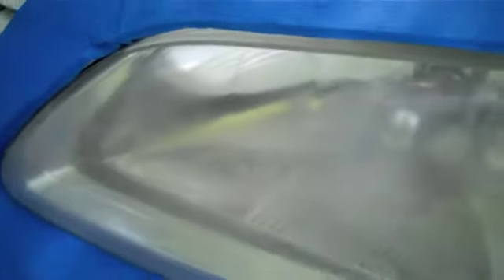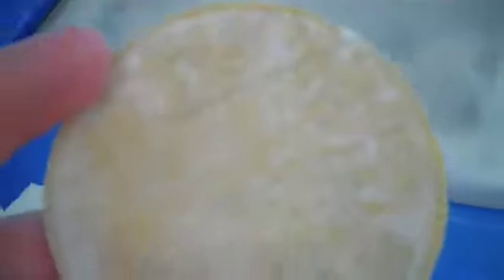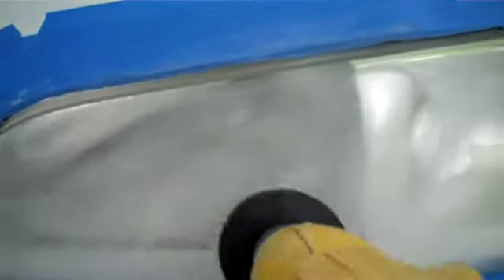There are just different spots where it's faded and grimy, so hopefully I'll be able to sand it and get better vision out of there. Your sanding disc can get pretty clogged up quickly depending on how bad your headlight is. I've started to sand and it's getting a little bit of a haze, which is just what I want. I went ahead and switched my sanding pad. You don't really have to push hard, and using two hands is better — I'm holding the camera, so I'll put it down and keep sanding.